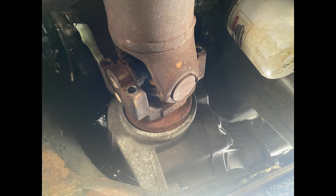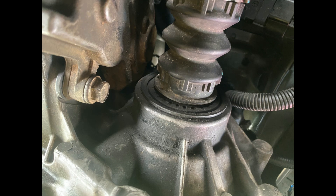Now you are ready to reinstall your drive shaft, making sure that everything is phased in according to the paint marks that you put on it before you removed it. Be sure that the rubber boot is properly seated where the drive shaft goes into the transfer case.